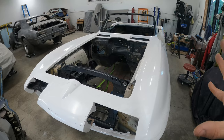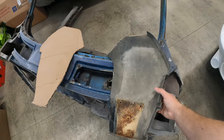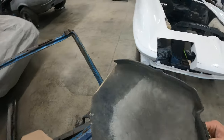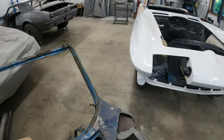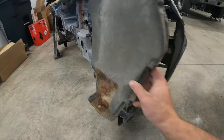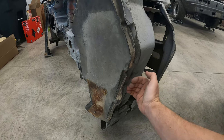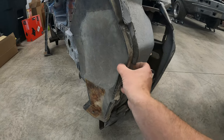I'm getting the front end fitment dialed in on this 63, but now I want to get these plenums modified. This is the original plenum for the car, and it has these little cutouts for the louvers. He's putting a 65 and 66 front end on this, and conveniently I have a 65 here to show you the difference. Instead of having these little whoop-de-doos in here, it just has a cutout so it covers up the firewall and blends in with the gills.